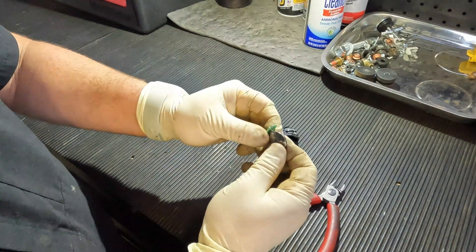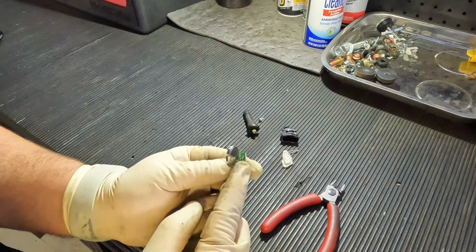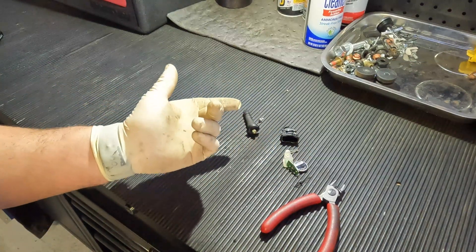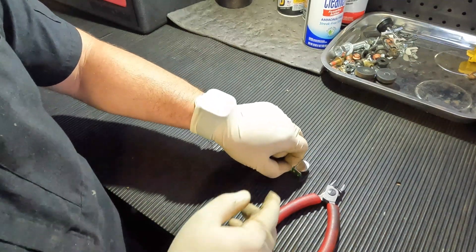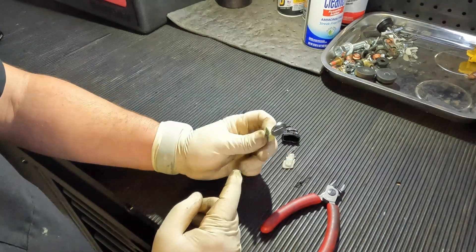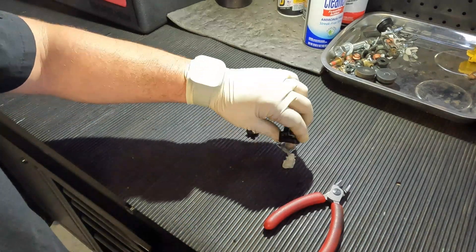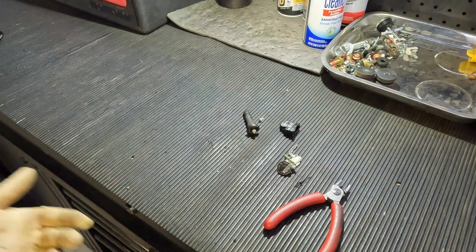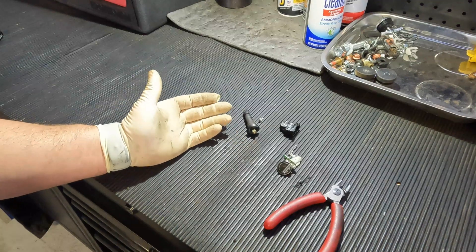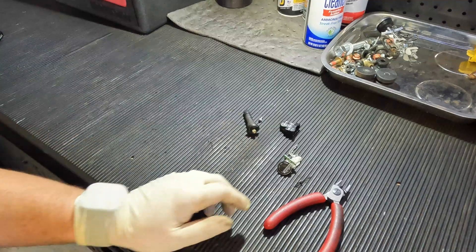The other thing too is if you look at this battery, it doesn't slide out — it has welds on there, so they basically make this forever together. Now you can probably get around that and fix it, and if you were very careful and didn't break that little part of the sensor and pulled it out carefully, maybe you'd be able to replace it and use it by sticking it somehow back together and taping it in your wheel. But realistically, it's not worth it. You can get a tire sensor now for around $35 to $50 — they're not as expensive as they used to be. So the best option is just replace these all the time.